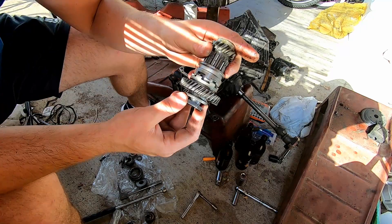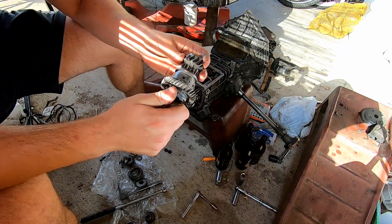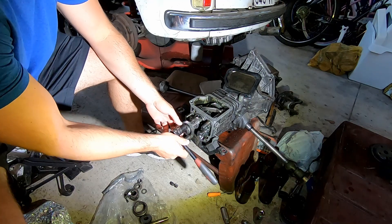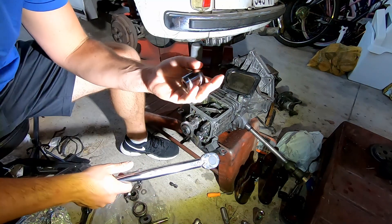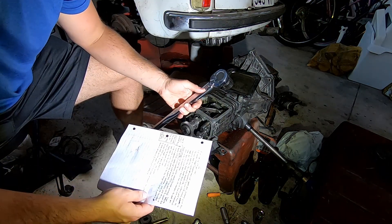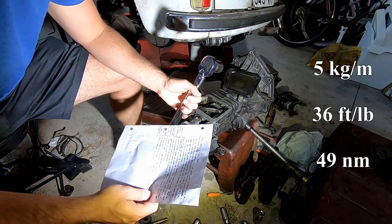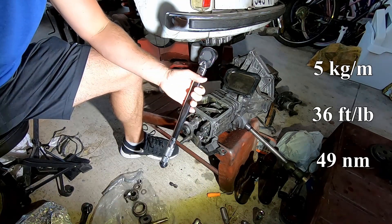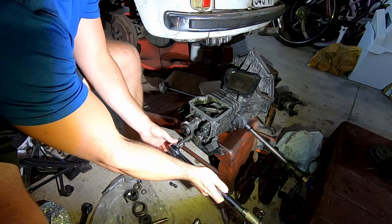There's no reason why you need to take this apart, so just try to keep it together. After you tighten this down by hand, then you're going to want to use a torque wrench - it's going to be a 27 millimeter. Set your torque wrench to 5 kilogram-meters, or 36 foot-pounds, or 49 Newton-meters to tighten this one and this one later on.